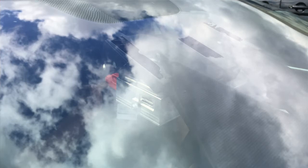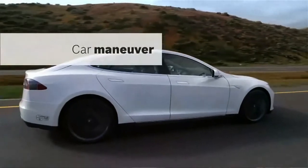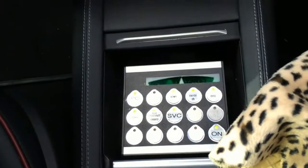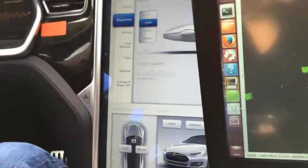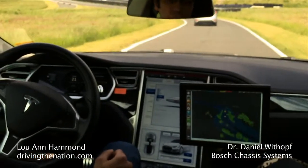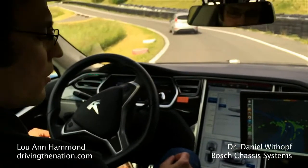But there are sensors that were on the vehicle even before you added yours? Well, the ESP was already there, yes. But all the real environment-perceiving sensors we installed ourselves. It's more than adaptive cruise control — the function we're seeing is similar to ACC, but we're also steering the car and making the decisions. ACC just does speed adaptations.